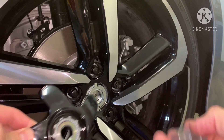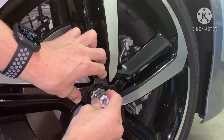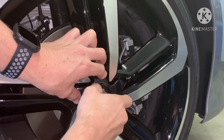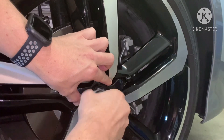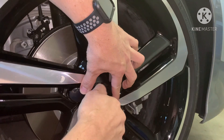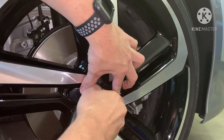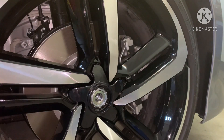You're reversing the process now — set it up with the notch cutout on that ring toward the top. Just keep tightening it; there's no specific torque spec here, so hand-tighten until you can't go further. You want to hold the union centered over the lugs as it has a little play — just center it up there and keep tightening it down until it's pretty snug. Then take the little allen key they give you — everything's included — and tighten it hand tight.